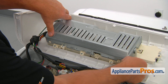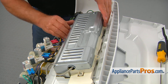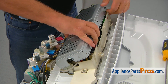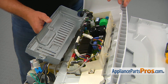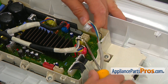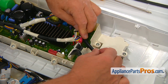We need to take this cover off in order to get to this connector. There's a single Phillips screw here at the bottom — I'm going to remove it. In order to open this cover, we're going to have to push it from this side and then lift the other end to remove it. We need to unplug this connector. Using a flathead screwdriver, I'm going to bring it in there, push down the locking tab, and disconnect the cable. Now we're going to connect the new one and plug it in.